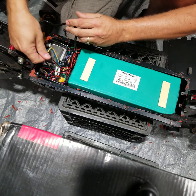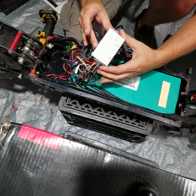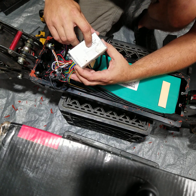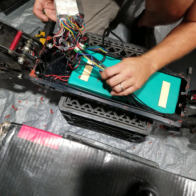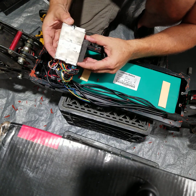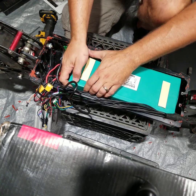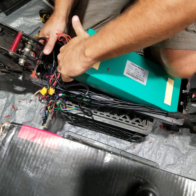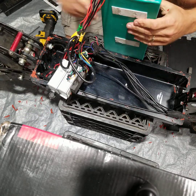Here's the wiring — it's all jumbled in there with the controllers. These are your two controllers right here; they say 52 volts at 25 amps, JMP controllers. I tried to look up the part number and couldn't find anything, so I don't know if it's proprietary. They also have all this white goo on them, which is just heat sink paste. The battery was initially stuck due to the double-sided sticky tape, but you can carefully pop it right off.